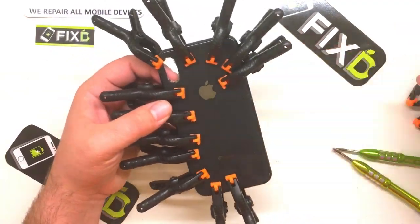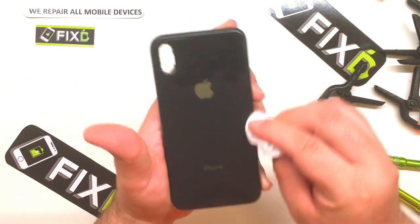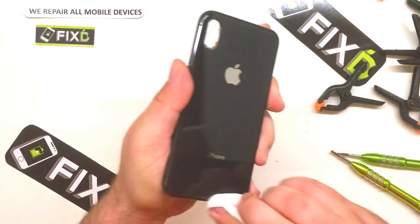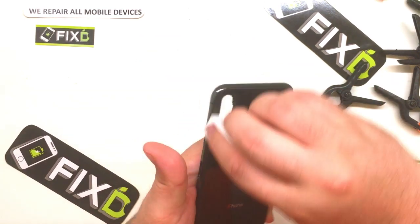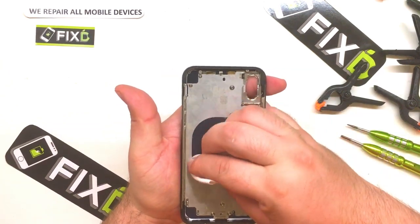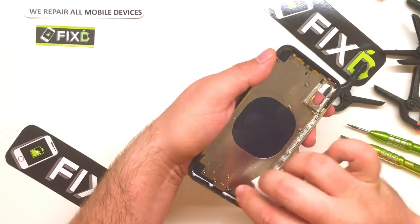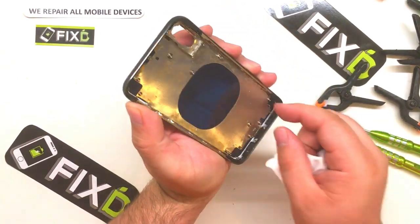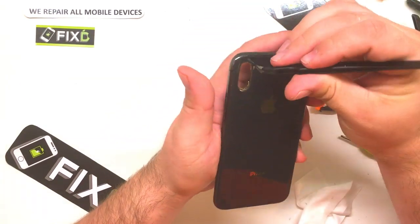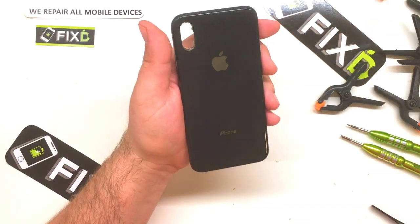Now that we've finished adhering and let the adhesive cure for the back glass, we're going to install the rear camera lens after cleaning up the edge and the interior from any excess glue that seeped out from under the glass on both sides of the frame. I like to make sure it looks really good, so I take my time in this process. I also want to make sure that the external charging unit sits flush, so I'll remove any excess adhesive — same with the charge port assembly as well. I don't want it to be lifted in any way, putting pressure on the speaker or anything like that. I'll clear away any adhesive that will prevent the camera from sitting flush against that frame, and I'm also going to bend back any part of that metal frame that we had to break to make sure that the lens fits well.